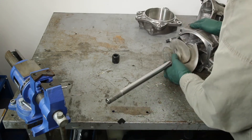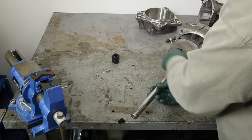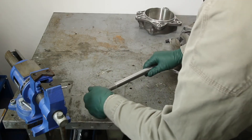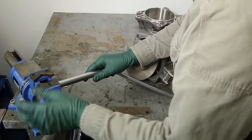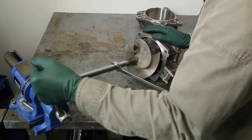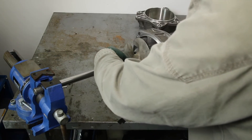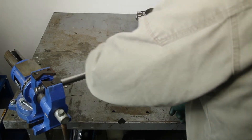You've got to remember which way we're going — righty tighty? No, lefty tighty, because these are left-hand threads. I just need a big box wrench for this. The manual says to torque it to about 54 foot-pounds, but I doubt very many of us have a torque wrench that can handle this application, so in this case you're just going to have to feel it. Remember: if you don't get it tight enough, it'll tighten itself for you. About 50 foot-pounds — you know a lug bolt is about 70 to 80 on a car, so not quite that tight.